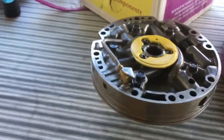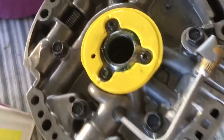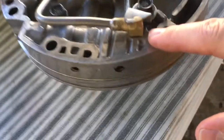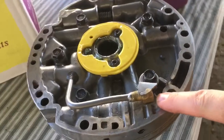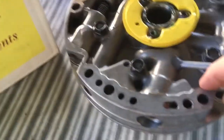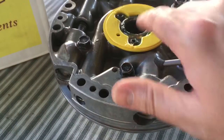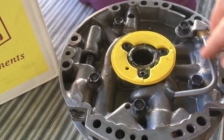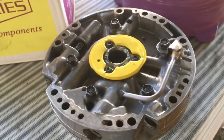The other modification we did is the Precision Industries pump modification for wide open throttle lockup, and that's where this tube comes into play. This tube is part of the converter kit from Precision Industries. It goes into a hole on the back of the pump — which is now covered up — that is your torque converter exhaust port. Normally that fluid just flows out into the transmission, but here it's being redirected back into the pump intake. So it vents the torque converter exhaust fluid straight back into the pump suction to help evacuate the converter side for wide open throttle lockup.